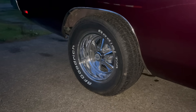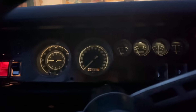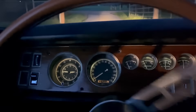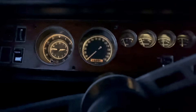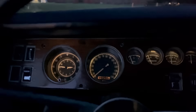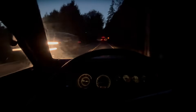This is now a really sweet running engine! Tom went ahead and aired up the tire — he seemed really concerned about that. It's almost like they're brand new and cost a ridiculous amount of money or something. I wish the heater had worked when I drove it 1,800 miles. The biggest concern when messing with the timing like this and not totally sure what's right — pinging. Pinging is ignition spark that happens too fast; that can melt things, so you always want to be listening for pinging when you're tuning like this. It'll happen the worst under a heavy load — meaning hard throttle going up a hill. No pinging.